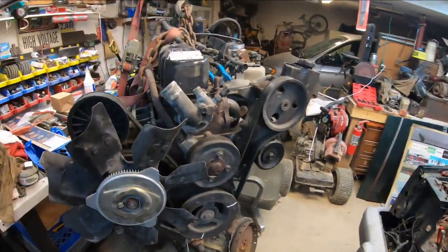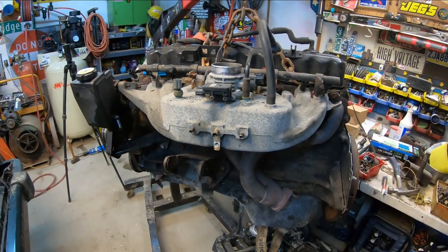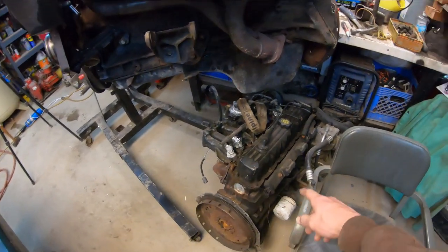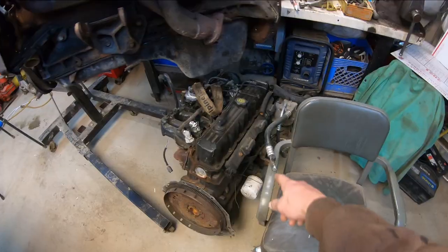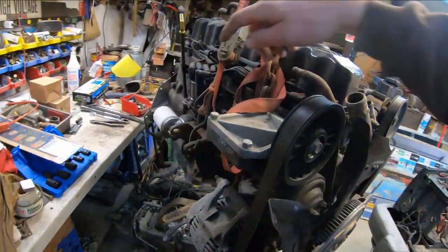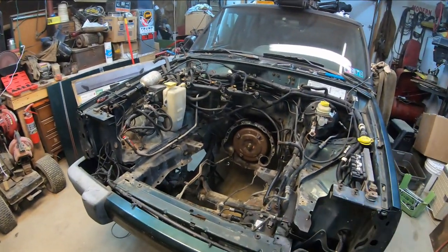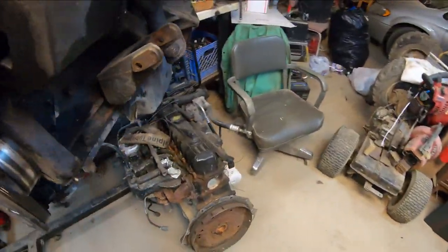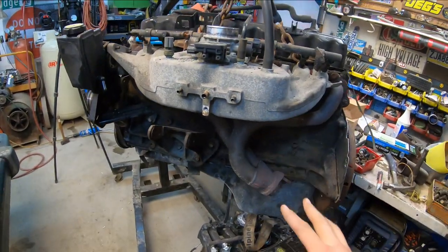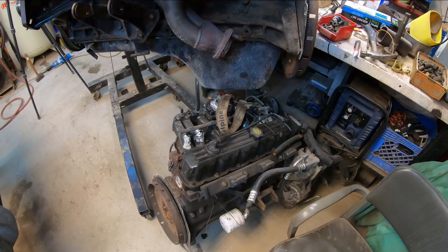So if you haven't seen the last episode of this Jeep, the link is down in the description to that video. But anyway, here's that engine that we pulled out of here. In the last video, I discussed that there are a few key differences on this factory engine versus the replacement, so we're going to have to do a little part swapping to make it work. This one has coil packs for the ignition system and a cam position sensor down here. Our factory engine still has an old school distributor system on it, so we're going to have to swap that over, because I'm sure the computer and the wiring would not work to run the coil packs. And secondly, our intake and exhaust manifolds are different on the original engine versus the replacement I picked up. But the blocks are all the same, so it shouldn't be an issue.